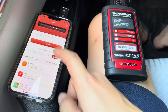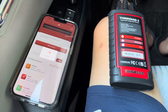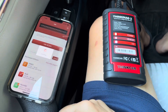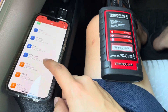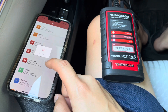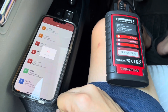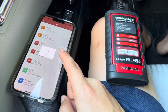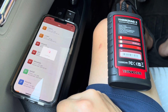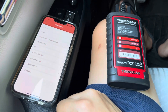Lastly, we're checking out the all system diagnostic, which allows for VIN scans. Using the computer, we can check that the VIN of the car actually matches what's probably in the glass or other parts of the body. While in this diagnostic section, there are a lot more vehicle makes you can see. For example, my other car is a Maserati — I tapped on that right away to see the capability, since it was surprising to me that it shows up in the automatic diagnostic section but not in the OBD function and the other section in the top menu.